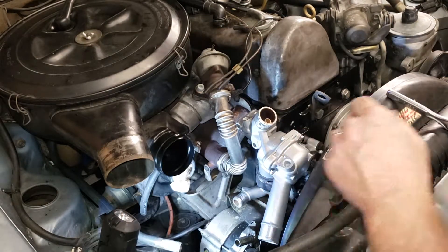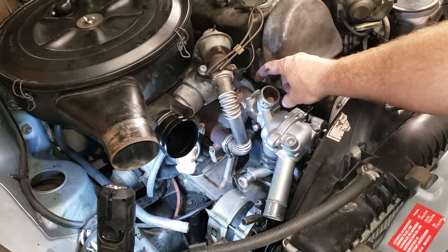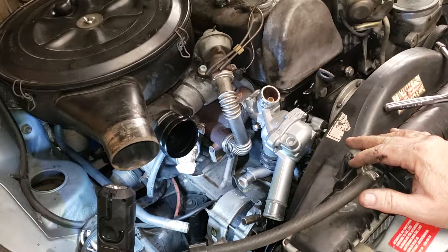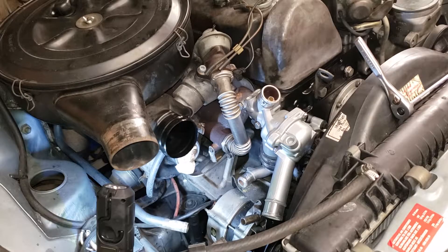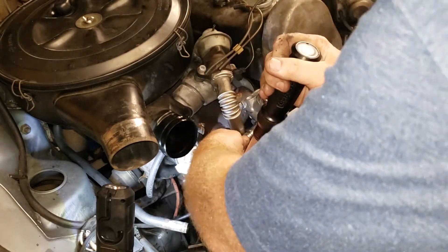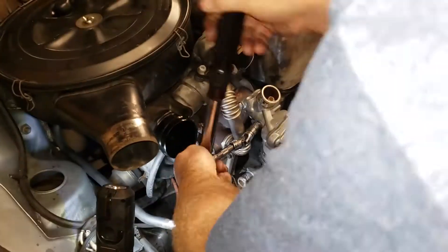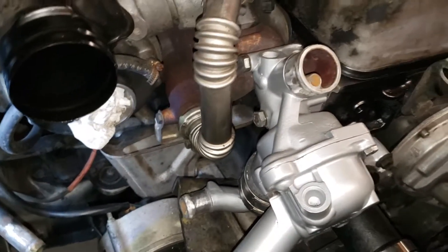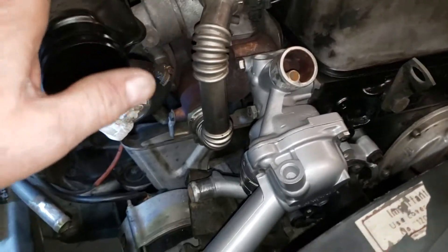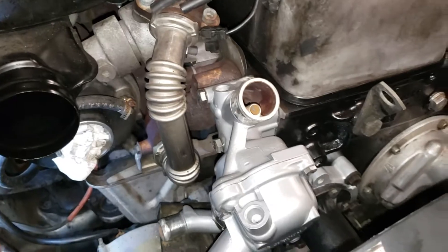Getting that on there was a little bit tricky — you have to contend with lining up the bolts on the thermostat housing that connect into the engine block, plus this small hose down here, and it all gets a little discombobulated. I could take the EGR valve off to make this job a little easier, but I don't want to. We got the thermostat housing buttoned up on the engine. I torqued these down to about 17 or 18 foot-pounds. If I see a little seepage I'll crank on them a little more, but it's an old car and this is a salvage housing, so I'm going easy on it.